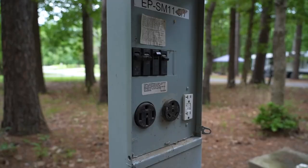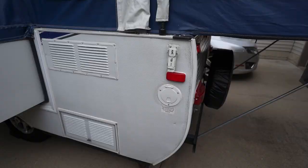So first things first, how do you get power to your pop-up camper? There are two basic methods. The first and possibly more common is shore power — that's 110 or 120 volt shore power when you plug into an electrical post or at home. The second method is via a 12 volt deep cycle battery, since the majority of your pop-up camper's electrical components operate off 12 volt.